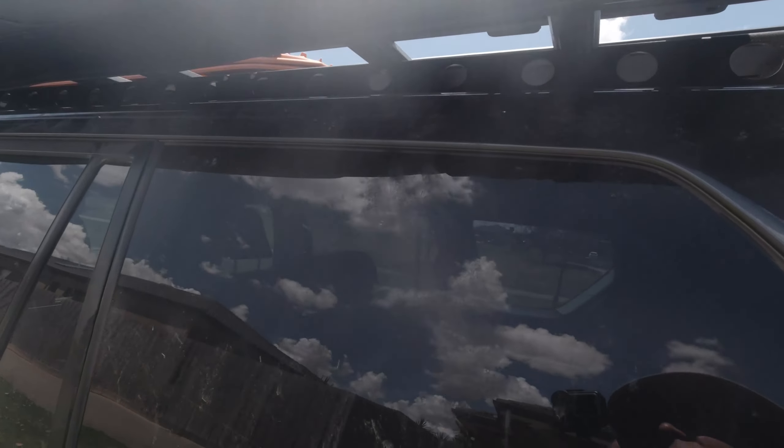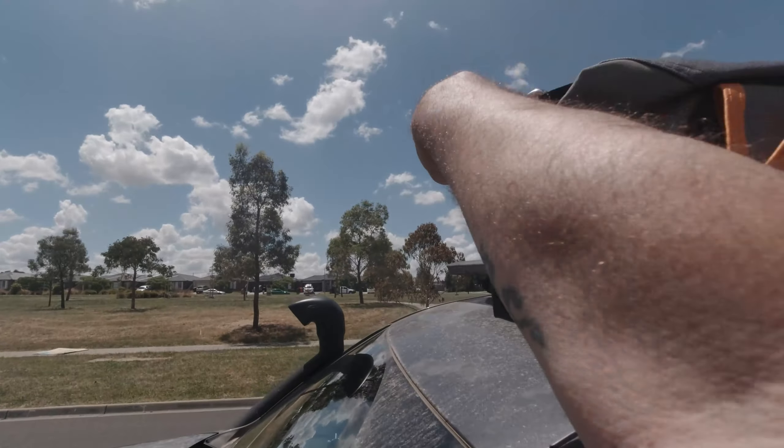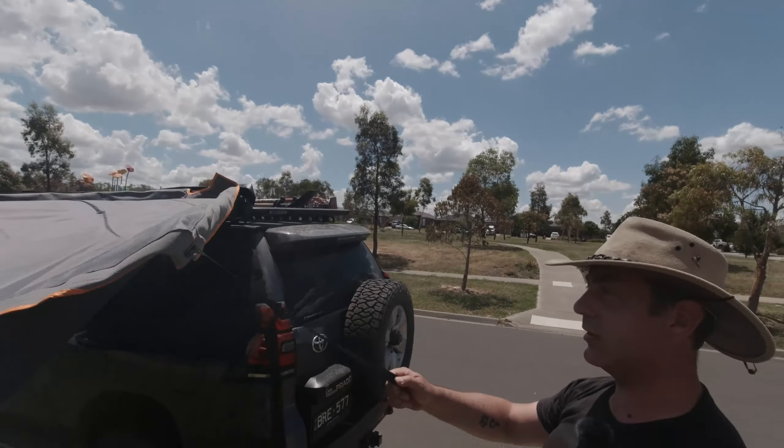All right, so that's in there. All we do to open it is fold it back — we're in. On the other side, fold it back again. That's it done. Now I want to loosen these velcro straps. I've never actually done this before, so I'm going on guesswork really, but it seems pretty intuitive. Last strap and she's just going to open straight up on me. Nice and easy. Just walk it around and grab onto this hook here. I'm going to hook that onto one of these points on my roof rack and give it a nice pull to make it tight. That bar is now flush up against the back of the roof rack.